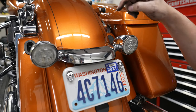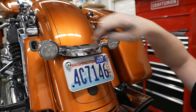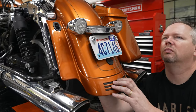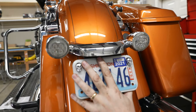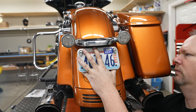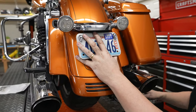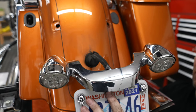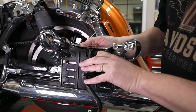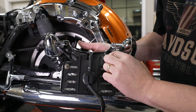On the back side of this light bar are two bolts, both sides. You just have to reach up underneath the fender with a half-inch socket — you've got to just feel your way up there, but you can see them with a flashlight if you shine up in there. Work on backing those out, making sure you support everything because that's going to free it up. From the inside, just push it on that grommet and pop it out. This is the back of the signal bar — yours may have a red reflector connected with two Torx T27 bolts, so you'll have to remove that if it's on there.